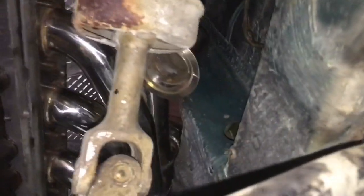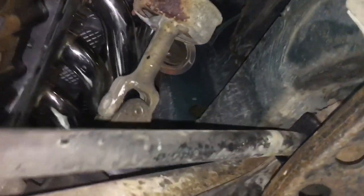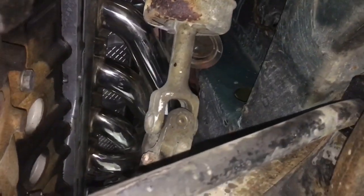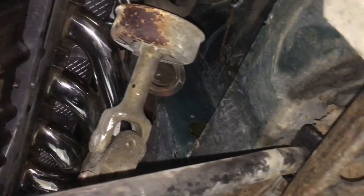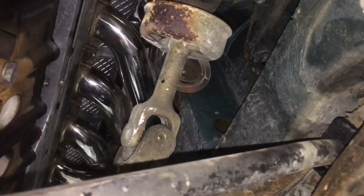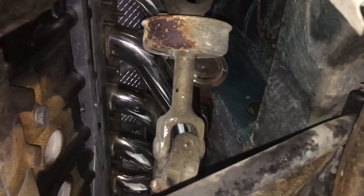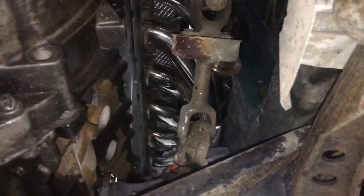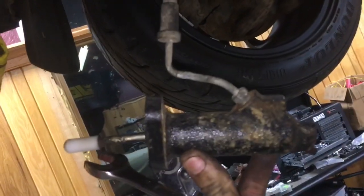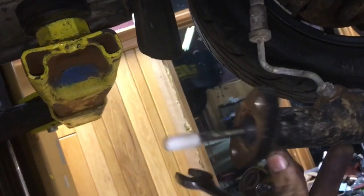Eventually I'll probably have to move this car to solid engine and transmission mounts due to the exhaust clearance, which is going to be tremendously close around the steering shaft. I have to get around the clutch line, which on a right-hand drive is right up there, and this steering shaft is right in the way of just about everything. I may end up cutting off that wastegate flange to get a little bit more room, then drop the main exhaust tube right there. Otherwise I could consider heat wrapping or ceramic coating the downpipe — probably both pretty good options. I still have to swap out the slave cylinder — that's got to be the late-model style E36, 46, 39, whatever.